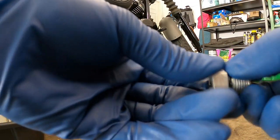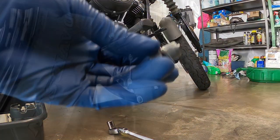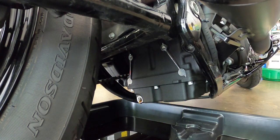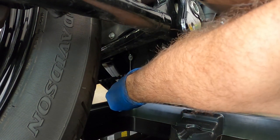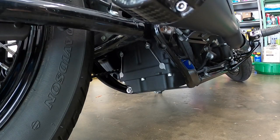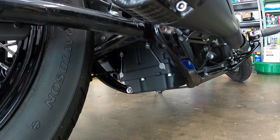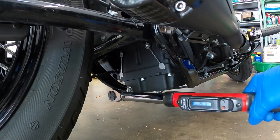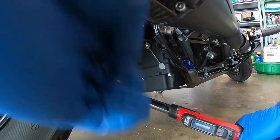It's down to a slow drip, so we'll go ahead and put our plug back in with our new o-ring. Make sure your o-ring is lubed up with a nice bit of oil. With the drain taken care of, we get our torque wrench — the drain plug bolt torques between 14 and 21 foot-pounds. I put mine at 19, kind of in the middle. We'll go ahead and torque this down.